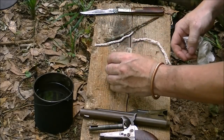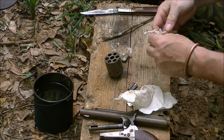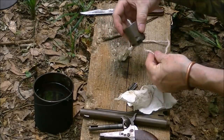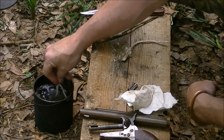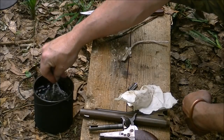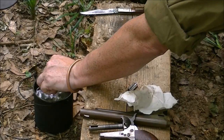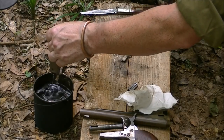Now my cylinder. I'm going to take two of these pipe cleaners, take the end, twist it together real good and tight, and thread it through the center of that cylinder. I'm going to dunk it, pick it up and let the water run out of the nipples. If your nipple isn't clear it won't run down — that'll give you a clue that one of your nipples is fouled out. I'll let it sit in this warm water for a minute, agitating it a little, which should dissolve all the fouling inside that cylinder.